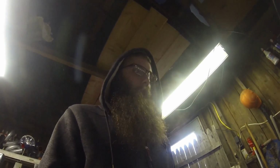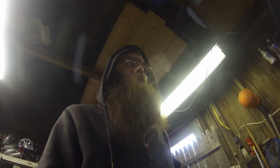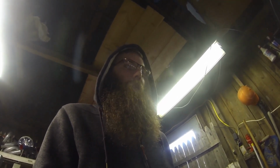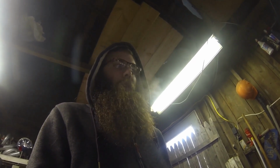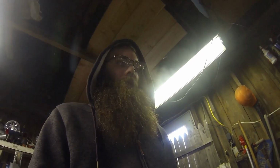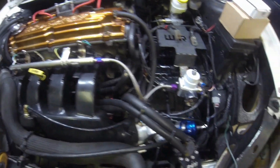Anyway, as far as power goes, what we had in the car was a Walbro 255 in the tank that we did a bottleneck fix with, Aeromotive regulator, ported intake manifold, Modern Performance 62mm throttle body, Fuel Injector Clinic 1100cc fuel injectors. I used a stock 03 rail so we could do a short line to the regulator, just the way we could regulate the pressure, not have to buy anything fancy.